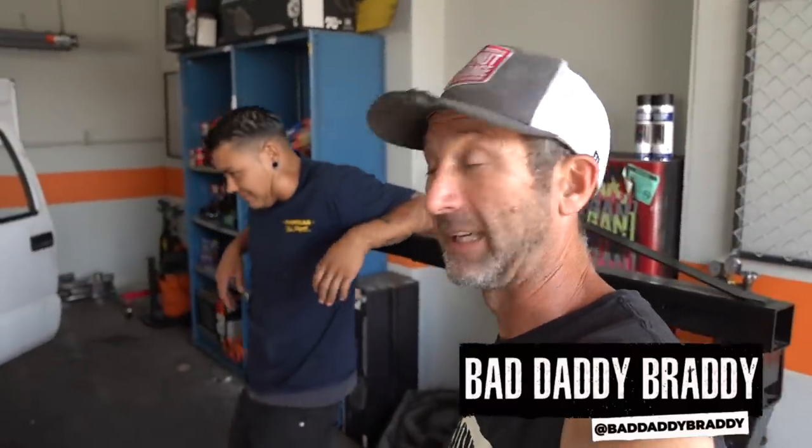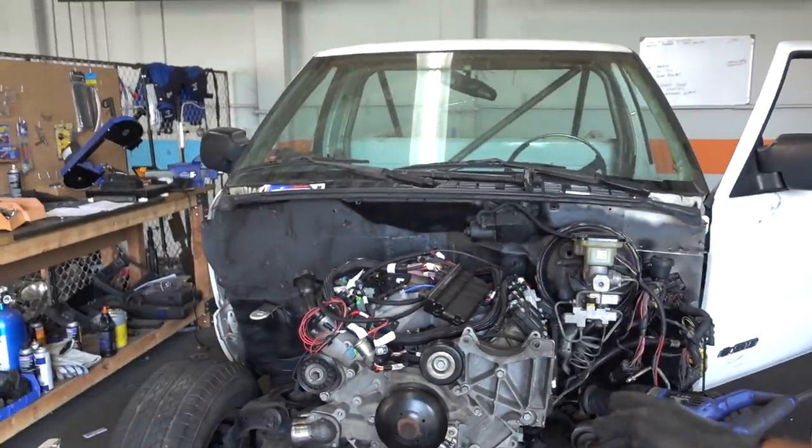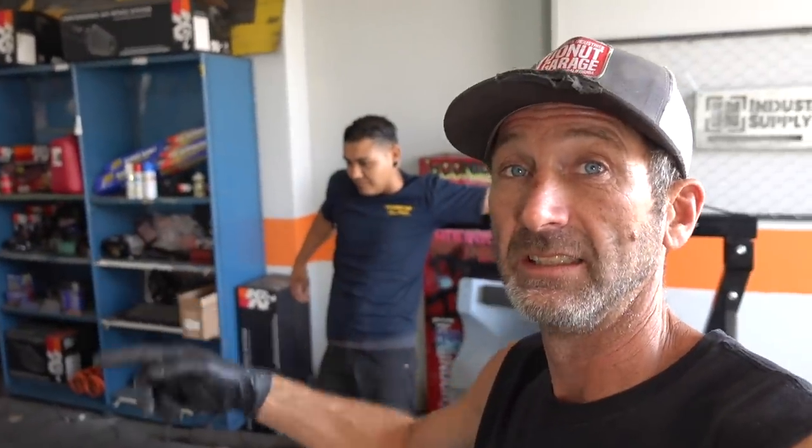Welcome back guys. Had a great weekend, we're all rested, ready to go. As you guys remember, we had the motor in. We gotta finalize some bolts, get the trans mount done, Jose's gonna get the cage done. We're getting our wheels and tires today, so we're gonna finally center the rear end and weld that in. I'm going to measure for the driveline and send our driveshaft out to get redone. Maybe by tomorrow we have a complete driveline and a rolling chassis. So by Wednesday, maybe fire up.